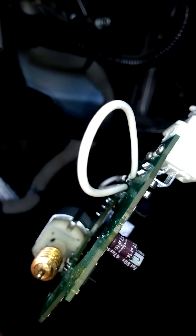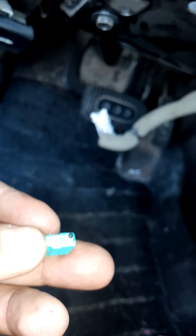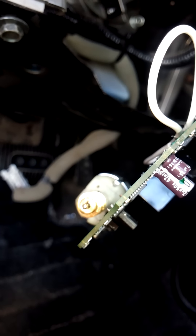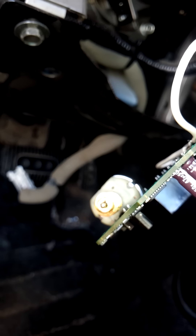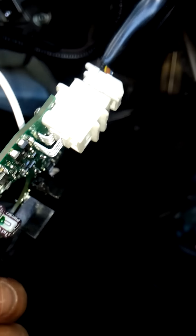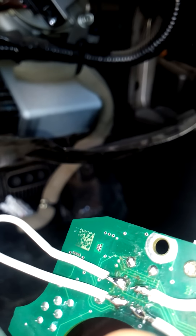To start the car, you need to push down on both switches at the same time, hit the brake, then hit start with the key fob pressed up against the start button. I didn't have much luck without the fob pressed against the start button. When you press it, you get accessory power and the car comes on. There are two positions on the switches — normally off and normally on.